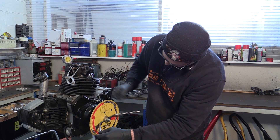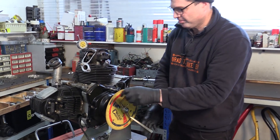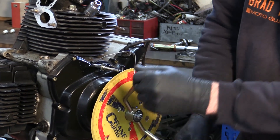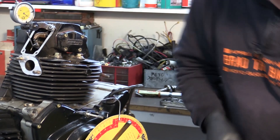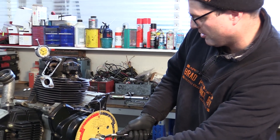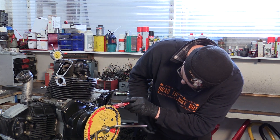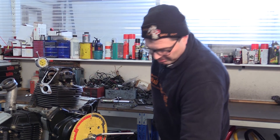I'll just pull it back a little bit and set it to 12. This is one of those things you get a feel for over time. Happy with that — I'll call that an accurate top dead centre. If you have the sight glass, you can set it at top dead centre and look through to see where it is relative to your mark. That way you can get a visual test for later to make sure it hasn't moved. This one is basically right on the mark, which is a bit surprising, but sometimes they're right.